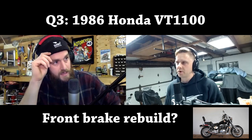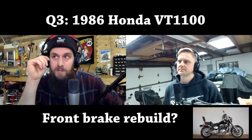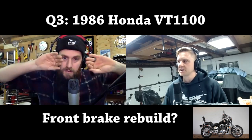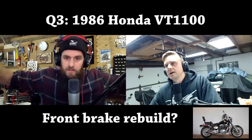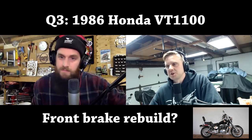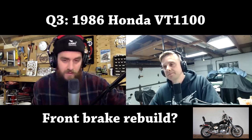It absorbs moisture. That's its job. Yeah, hygroscopic. Right? Hygroscopic, because hydrophobic is the opposite. And then eventually it has so much moisture in it, it's just sitting against the metal and pitting. Just corroding. It's a mess.